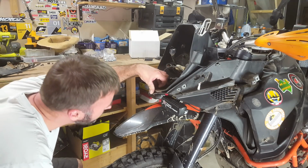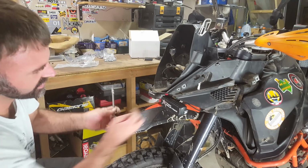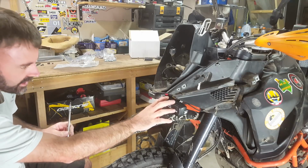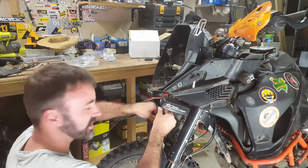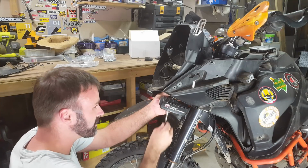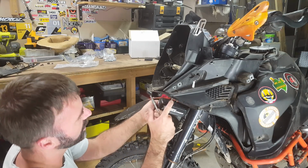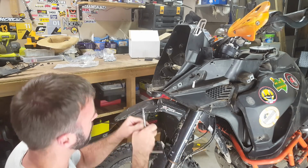Bugger, I sort of thought that I didn't need to do that, but we do because there's some screws behind here that we have to get to. So I'll take this bit off. Yeah, so there's 4 screws here that you need to undo. You probably won't have driving lights there, but you can see 1, 2. So those 2 hold this bottom panel on.